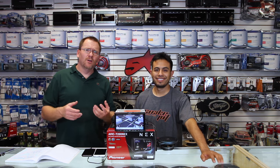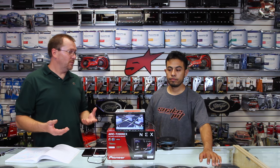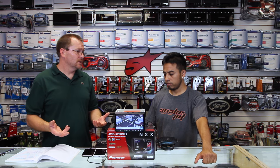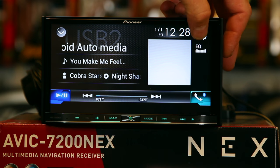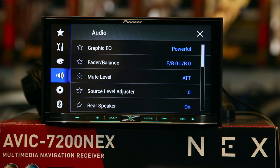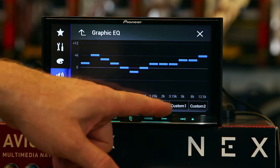Hopefully when you buy a radio like this you're not just buying it for cool little widgets like CarPlay and navigation—one of the nice things about an NEX radio is they sound really good. They have an amazing sound pack built into them. They have 50 watts by 4 of deck power. The preamp outputs are 4 volts, so you have 6-channel 4-volt preamp output—that's pretty impressive. Now let's find out about the sound pack. Hit the icon, gears, go to the radiating speaker option—this is going to take us into our sound pack. First thing up is the EQ: it has a 13-band EQ with 5 presets and 2 custom presets.